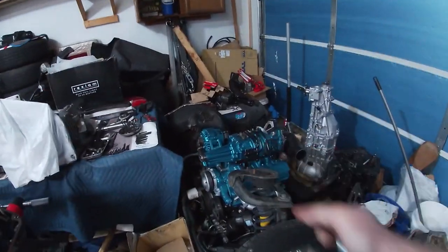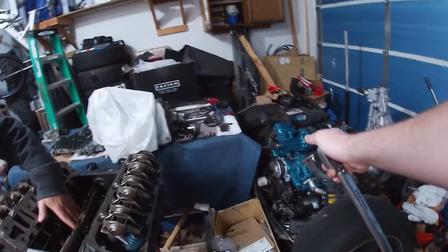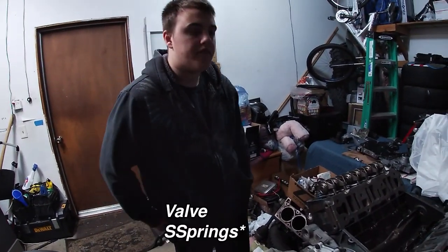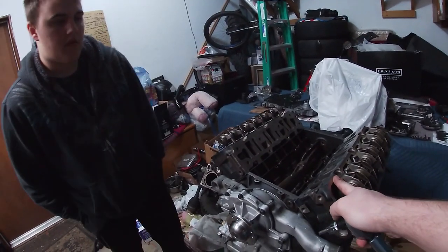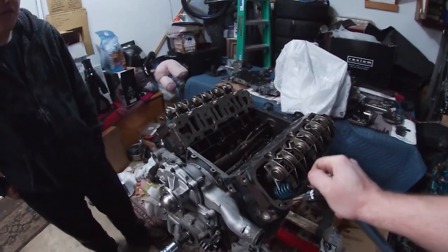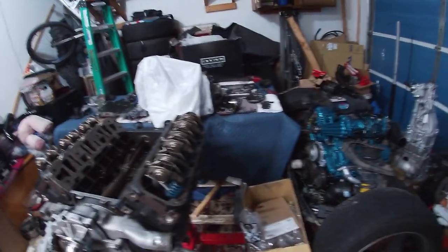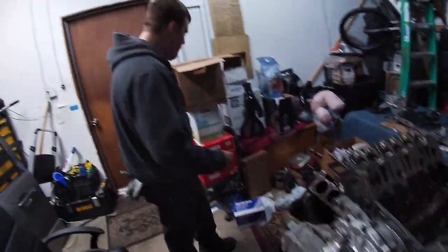Project F's motor is still in question. All I did when we constructed this valve train was we had the 130-pound lifters, then we had 7-inch push rods, which are spec'd for the cam — the XP cam — and stock rockers, and I just did them to torque spec. We'll check — it's really easy. We'll check just the first bank to see if everything's good, but all should be good there.